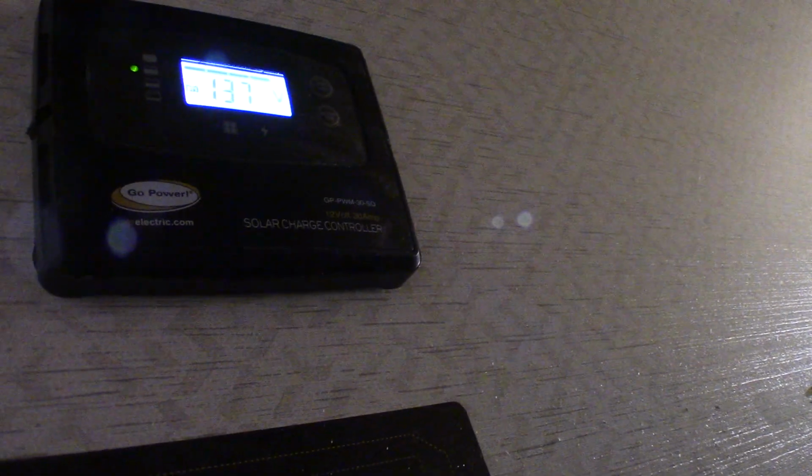But the main thing is, the only thing to keep an eye on is if it starts flashing, it'll flash FUL on and off, and none of the buttons will respond. If it does that, it's not broke. It's just telling you that it's full, that there's no more room for storage in the battery. So it's clicked off the panel till the amperage drops in the battery. Once that happens, it'll go right back to the normal 3 different readouts. But remember, if it says FUL and it's flashing, it's just telling you that it's totally topped off. There's no more room for storage. Okay?